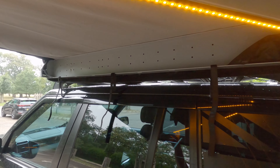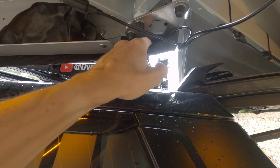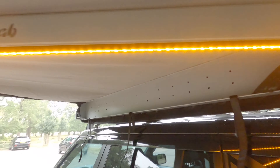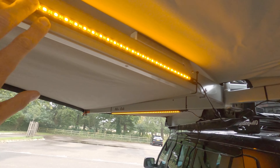You can get these from Drifter — they come in different sizes. This is the 900. I originally had one on the back of the tailgate underneath the lip, took one of those off, got a three-way splitter, and ran a cable through a hole I made in there, stitched that back up and sikaflex'd it so no water can get in. These are on VHB tape — I cleaned everything down, stuck them on, and to make sure they don't go anywhere I put some zip ties on here and here, and everything closes up fine without rubbing.